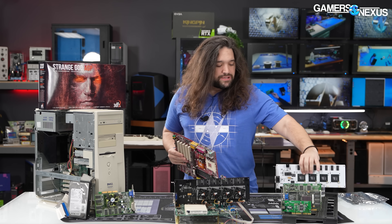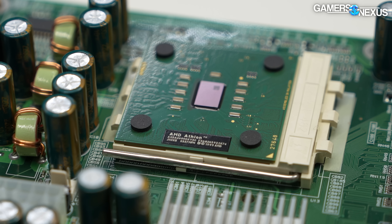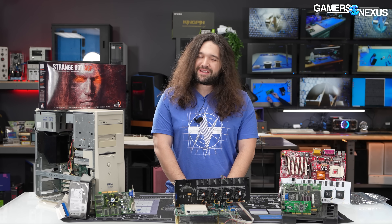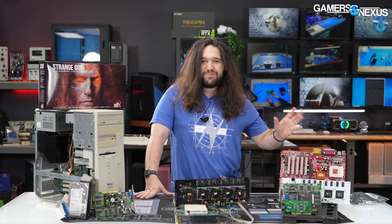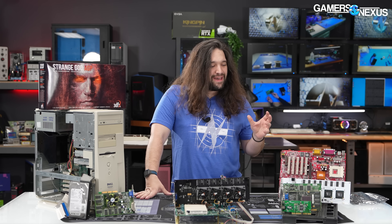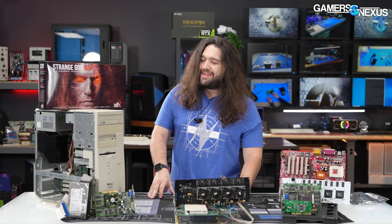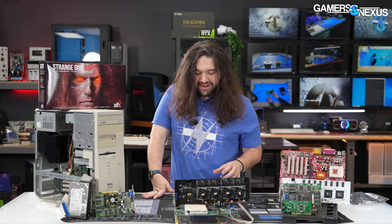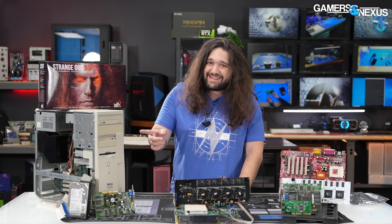We paired the MSI board with an AMD Athlon XP 2600+ Thoroughbred from 2002, where 2600+ meant 2133 MHz. Unfortunately, the MSI KT3 Ultra we sought for weeks on eBay showed up DOA. Our friends at the Cramden Institute, a local e-waste recycling facility, helped us out — they were able to secure us an extremely beige and extremely 1999 Dell Dimension after we told them it needed to run Windows 95 or 98 and needed AGP 1.0.